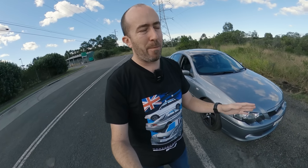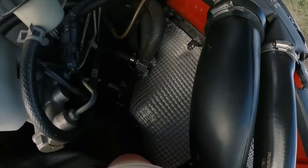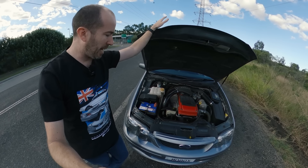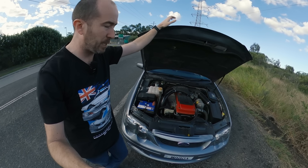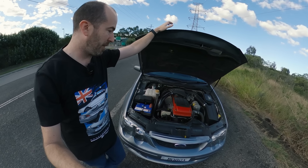If you were on the highway, for example, in fourth gear and you loaded this thing up — you almost went full throttle — the boost would just climb to the moon. It would go to like 20, 22 pounds, I think was the cutoff. You're running higher boost, you especially run an aftermarket dump pipe — which is what I've got here, a four-inch one. These things can no longer control boost with the stock setup; the stock boost controller and the wastegate flapper is too small to flow any meaningful amount of exhaust gas from around the turbine. It spools up way too hard, you get too much boost, you can't control it.